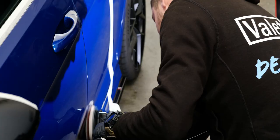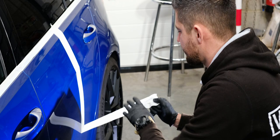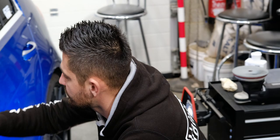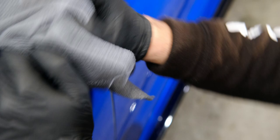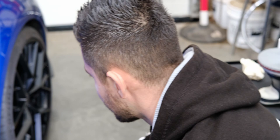We're just going to peel the tape off now and then reveal. We've just done a few passes there — nothing too crazy, didn't change pads or anything like that, just a few passes with the microfiber pad and the Advanced Compound, just so you can see what you can do. You can see a clear line there. Unfortunately that scratch will never come out — you'd go through the lacquer before you get that out, it's really deep. Some of the larger scratches are still here but apart from that I'd say you're probably about 86% done on the defects, and you can see there's a huge difference in the clarity of the colours coming through the panel. This is what you can achieve with our Advanced Compound, microfiber pad and a single stage pass. We decided to just do a single stage on this car because we've only got a day, so we're not going to go too crazy with it.